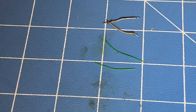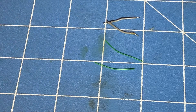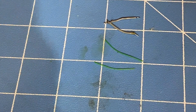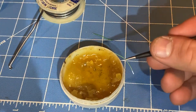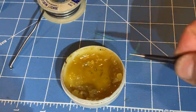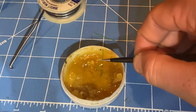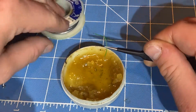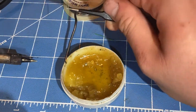I'm going to get the coat off of both sides and then tin them with solder. After I took the coating off both ends of both wires, I'm going to dip them into flux on both sides, and then put solder on them.